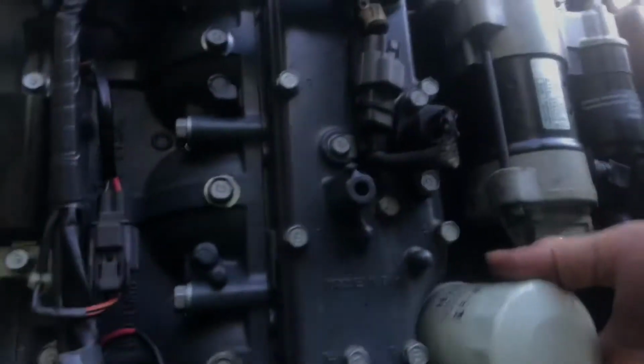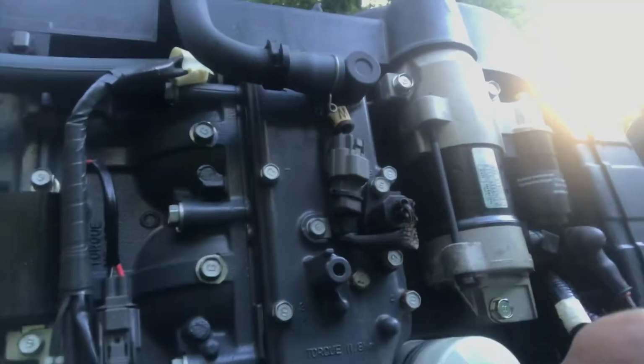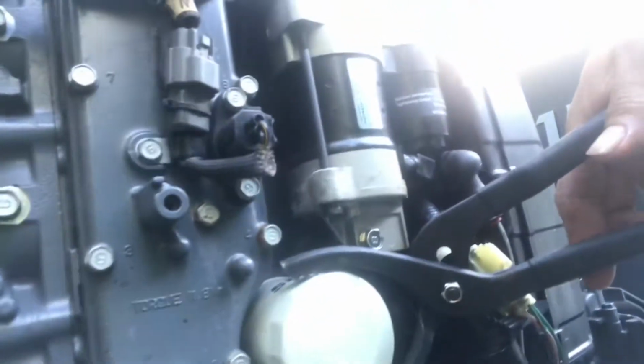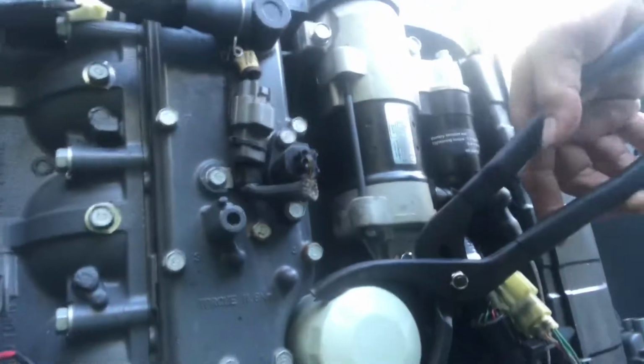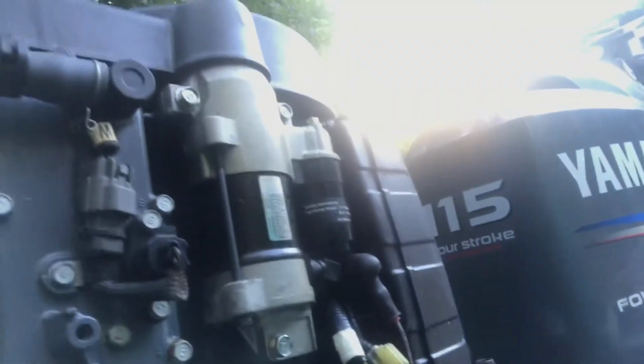Then you put on the new filter with the same number. Screw it on all the way, hand tight, until you cannot tighten anymore. Okay? Then you use the wrench and just slightly turn a little, less than a quarter turn. And that's all. Then you just put oil in here, and you are done. Thank you for watching, and have a safe boating.